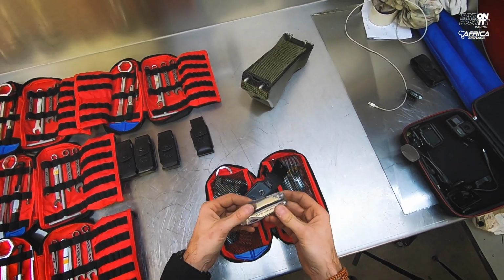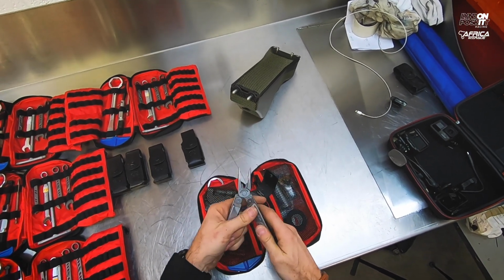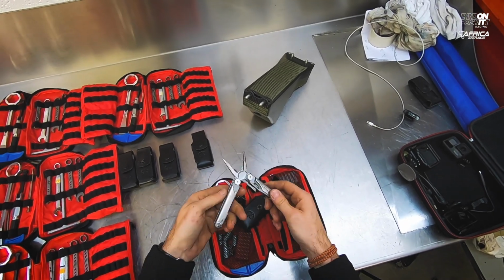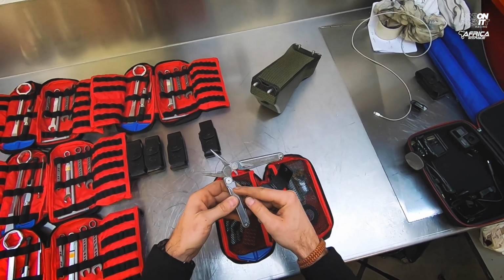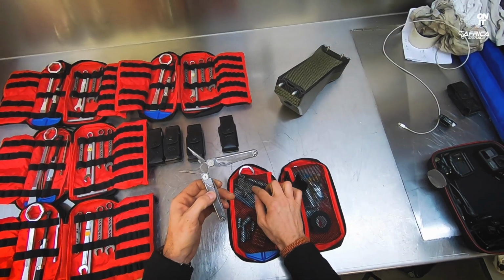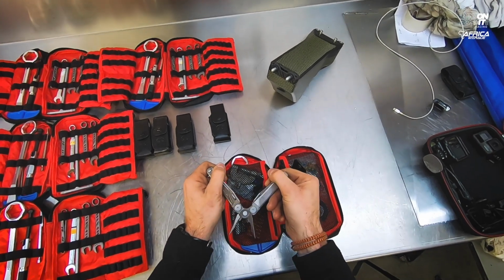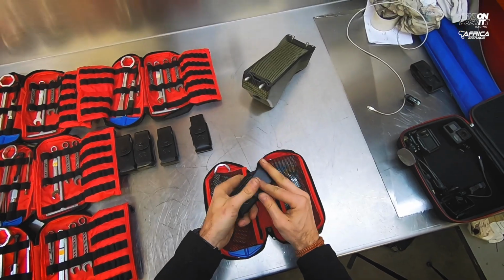It's my go-to tool, and that's this Leatherman Wave. They've all got a Leatherman Wave as a pair of pliers, side cutters and knife, and every single thing else that they've got on there. They've got some little mini screwdrivers, scissors, files, you name it. Now, I use the file on this to file the rivet down on the rivet links on the chain before I use the chain tool, and that just saves the stress and pressure on the chain tool a little bit, and I'll be talking to the riders about that as well. So that is the Leatherman Wave.